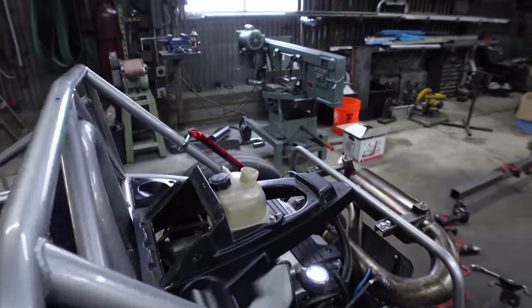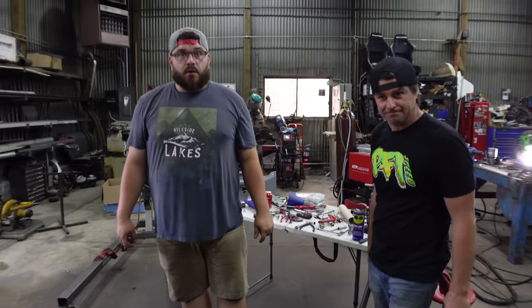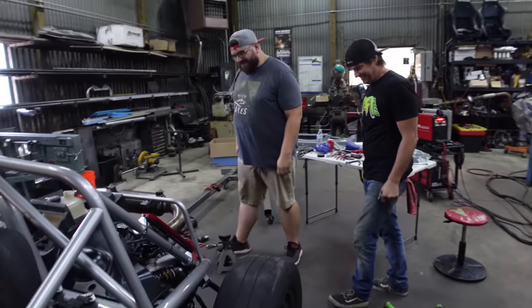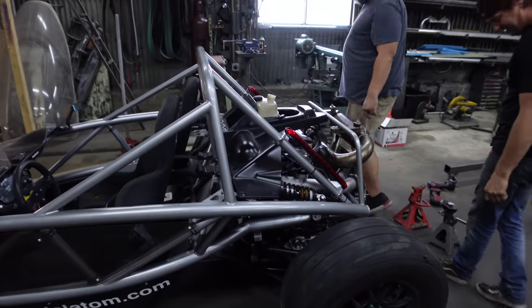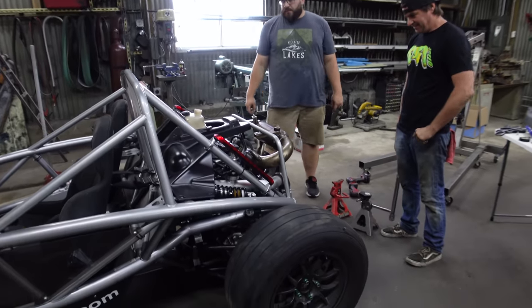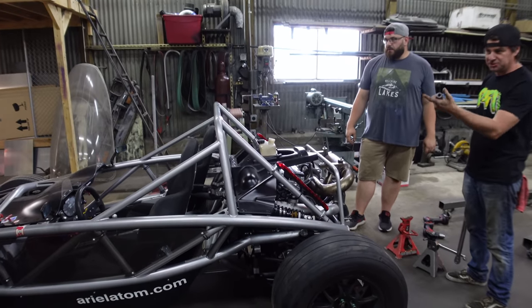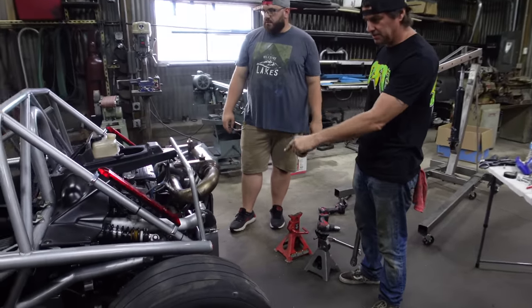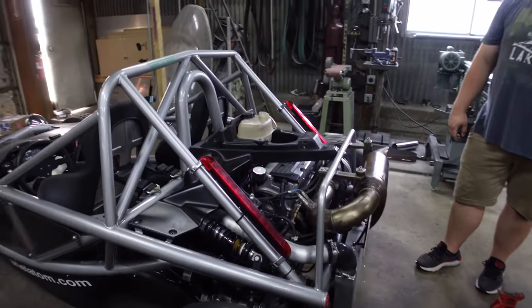Obviously, we know it runs. We're ready for coolant fill. Brent and Kyle just torqued the wheels, so that's good. Good to go. And, man, we're home free. We really are. Like, we could drive it now. We just need the magnet. I think that's just the dash speedometer. Because the factory one's still in the transmission and still wired up. And that's what the ECU should be referencing.